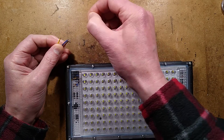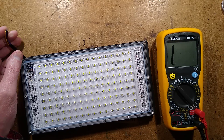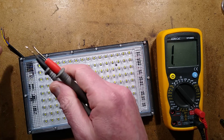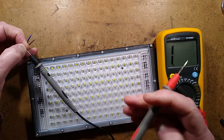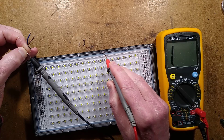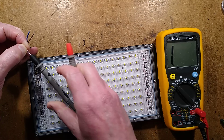Let's do the earth test first, where I will bring in the meter on continuity and we'll touch the earth wire — or ground wire if you prefer — continuity, and we'll touch a screw that is tapped into the case. It is not grounded. That's not a surprise.